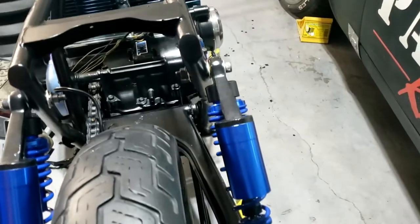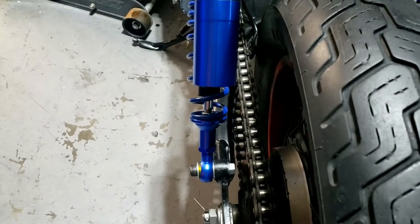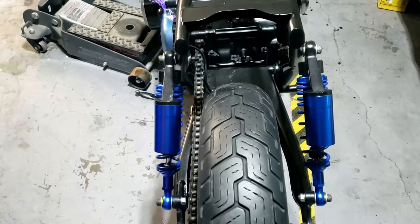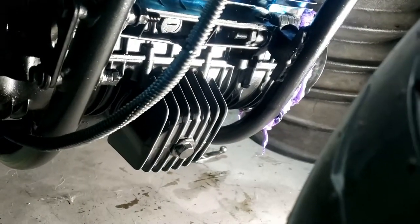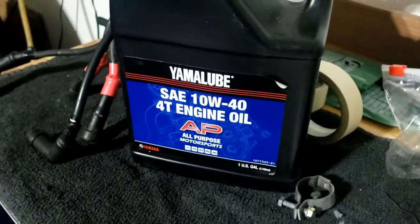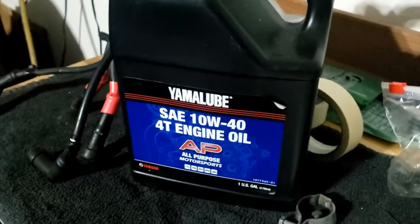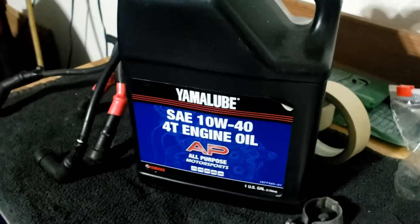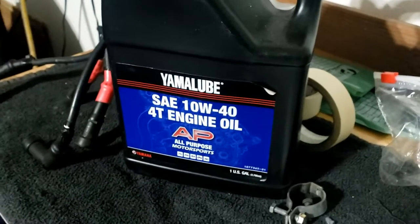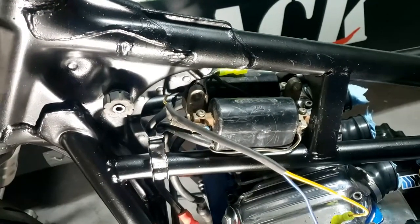I've now secured the shock absorbers and they look a little bit better — still not 100% happy with those. We'll see. We have an oil filter back in place — yes, coming together. That involved a little Yamalube, as it does. 10W40 is the recommended oil for the Honda — just a dab on the thread and a slight priming of the filter after my experiences with the stratos.